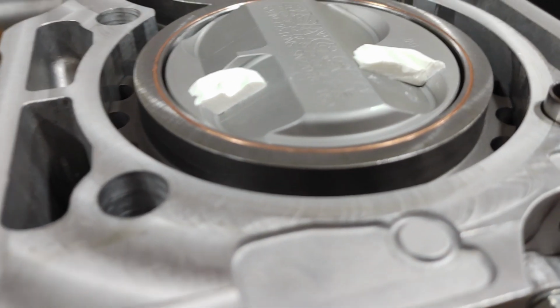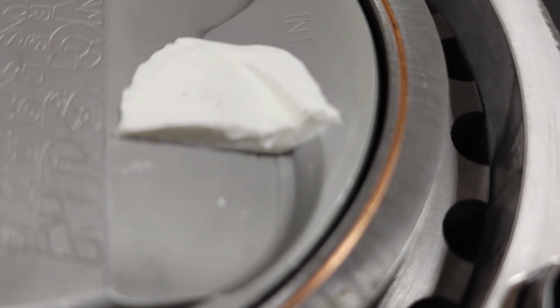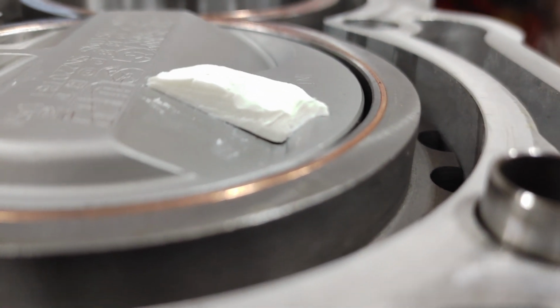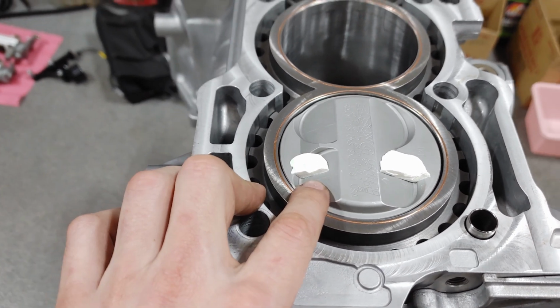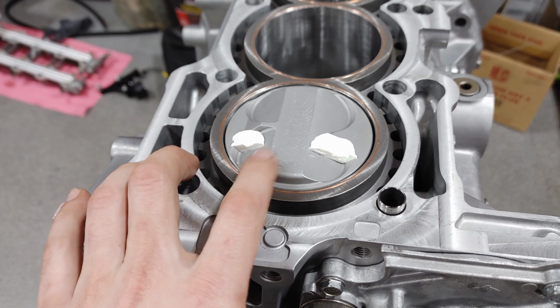And we're back with a cutaway. The intake valve is still, well, it looks like I smashed it messing with it, but it is not far enough away for my liking. So -2 on the intake is what I'm going to call my minimum. The exhaust I put at +1. Yeah, +1, and that's right at 100 thou, so that's solid right there.